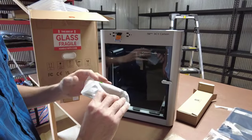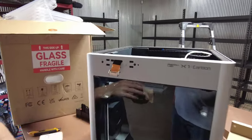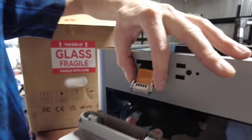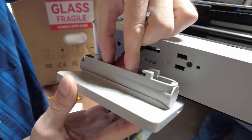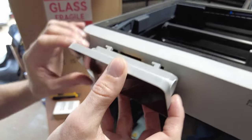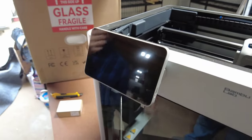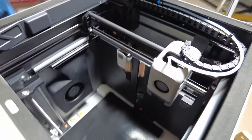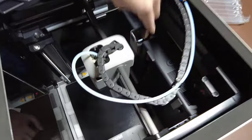We're going to go ahead and hook up the screen. It's fairly simple — you just want to be careful when you're pushing this ribbon cable back in that you don't pinch it. You can see we do have a spot for it to plug in. We're going to orient it, clip it into its mating spot — a little click right there. We're going to guide that in, push in and push to the left, and the screen is ready to go. Looking around to make sure there's nothing we forgot — and yes, we did have one piece of tape we forgot, and this is your filter.